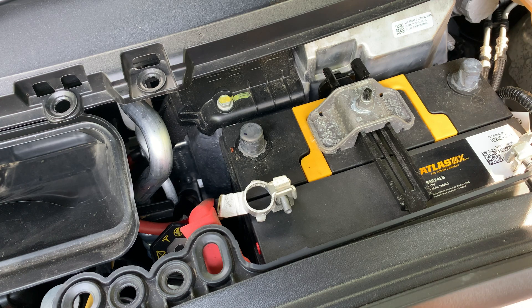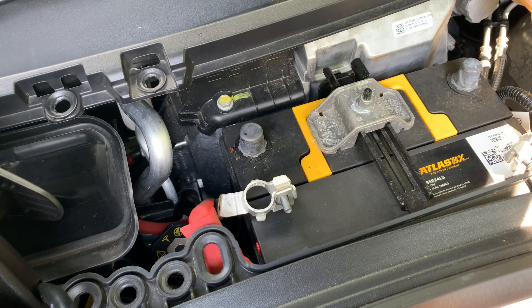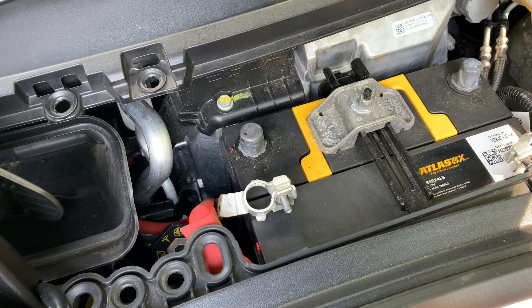When working on the 12-volt battery, make sure you don't touch the terminals or accidentally leave any metal objects that can cause a short. There are 12-volt lithium-ion drop-in replacement batteries for ICE cars — these are quite a bit more expensive but do weigh less. You'd think it would be great for an EV, but it turns out that Tesla's application of frequent deep charge and discharge cycles would greatly shorten the life of lithium-ion batteries designed for ICE cars.